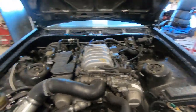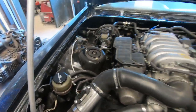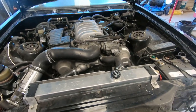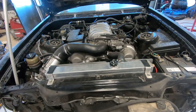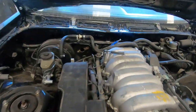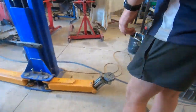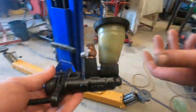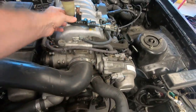A little bit of an update on the Supra — it's now got an air filter in it. The customer came in and did a few bits and pieces: put some foam in, put some brackets for the radiator, so that sort of thing is all working. Today we are going to be fitting up a clutch master cylinder, and hopefully that will give us a clutch. It's a factory one that's been bored out to 11 sixteenths.